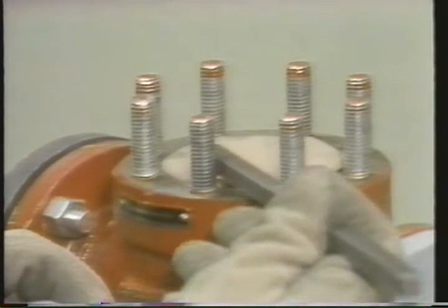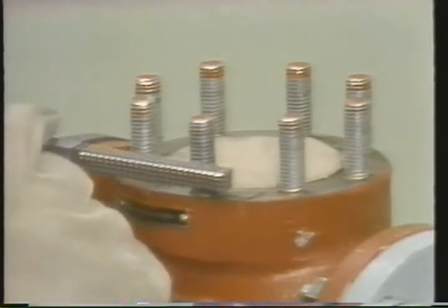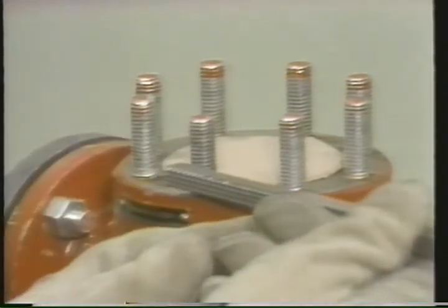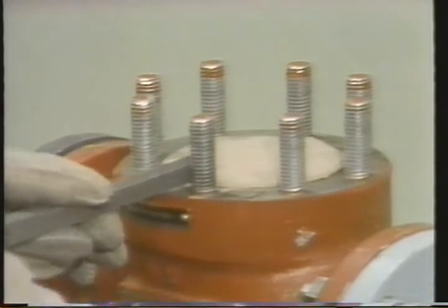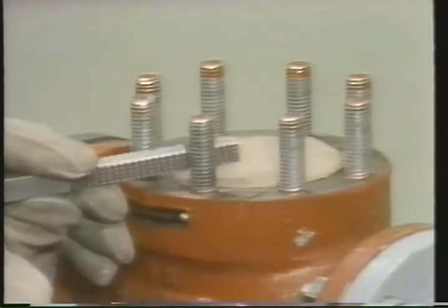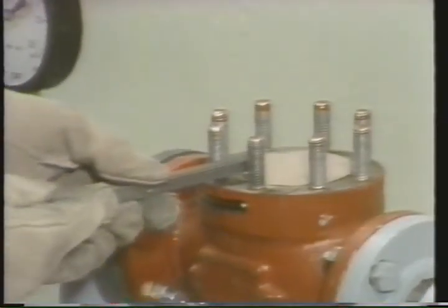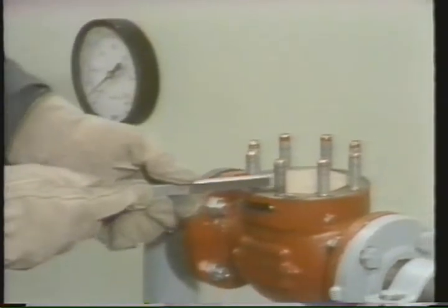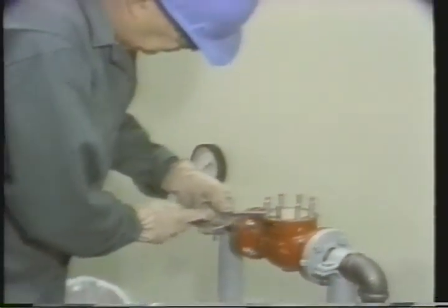This tool is an effective cleaning device as long as you're careful to match up the correct size of the threads. When doing the actual cleaning of the threads, take your time. Make sure the tool fits properly into each thread, and be sure to clean the entire thread. These particular studs are not that dirty, but often they get rusty and much dirtier than you see here. By doing the cleaning job well, it will make it much easier to install the body stud nuts later.